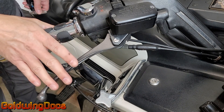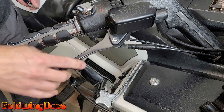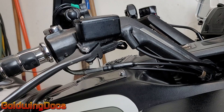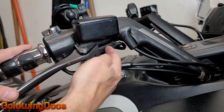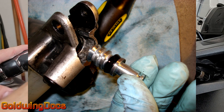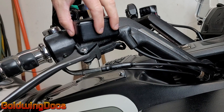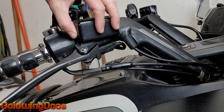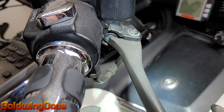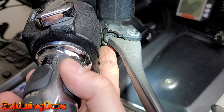The first thing we notice is we have a lever. In the world of physics, this is known as a lever that does actual work. We have a pivot here, an arm here, and another arm here. Attached to the brake lever we have the master cylinder with a piston inside, just like in our example, where we saw the piston pushing in and out of the cylinder. Here's the brake line fitting that runs down to the front brakes. Here's the brake reservoir full of hydraulic fluid — that's our root beer. And here's the head of the piston that gets pushed by the lever. As I pull the lever, it pushes that piston inward. It has a rubber surround around it to keep dust out.